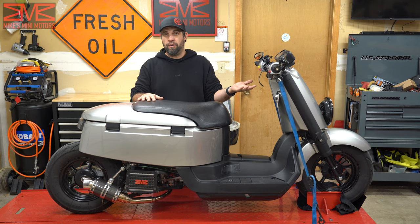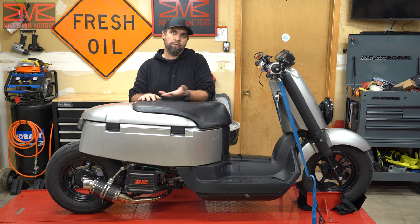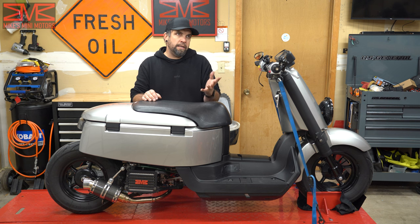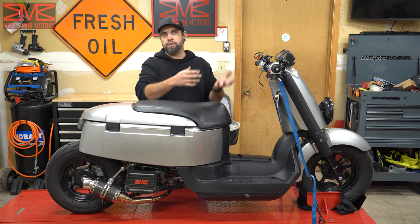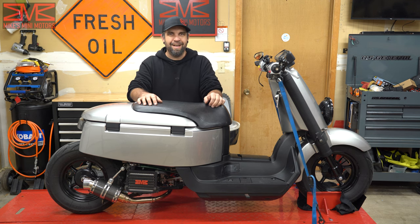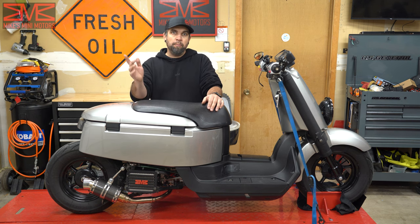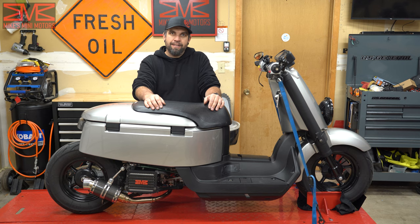From that video, we've already got some pretty good gains. Top speed was 39 mph on the before video and 47 on the after — so already an 8 mph gain. The eighth mile was about seven seconds faster, so acceleration is even better. And that's with the base tune — I still need to tweak it to really dial this thing in. In the future, I'm going to install a wideband O2 sensor in here and in the Ruckus, and I have a gauge and sensor, so I can tune them to perfection. But yeah, that's the big bore kit installed — not too hard, pretty straightforward. I'll put a link in the description for the parts. I'll go ahead and sign off, see you guys in the next episode.